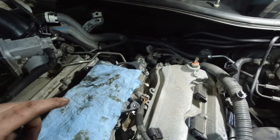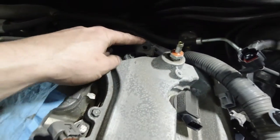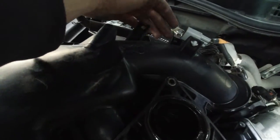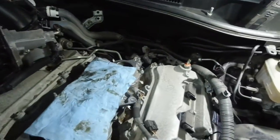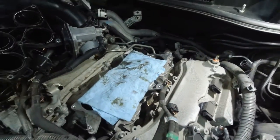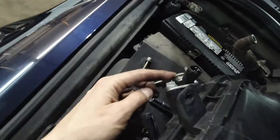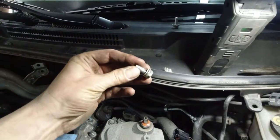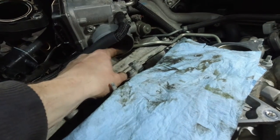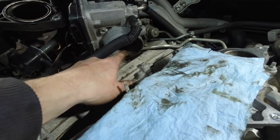There are two kind of hidden bolts. There's one right here and it connects right over here to the throttle body, and there is one here which connects to one of these. You can access this one right from here. There's also a bunch of harnesses you got to unplug and a fuel line right here that's connected here. Don't lose these washers. Look at this oil that came out of the throttle body. Every time you have access to the inside of the throttle body, clean it up.